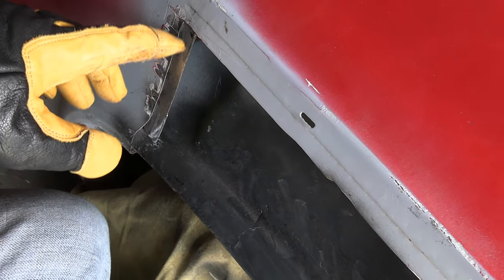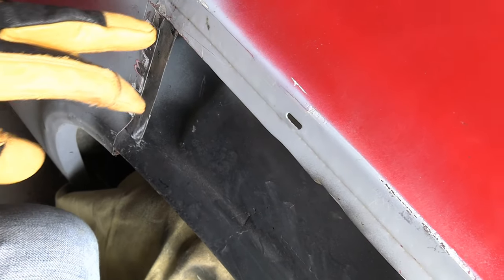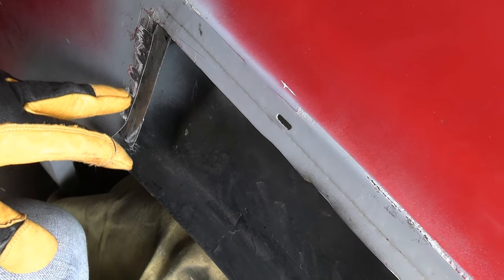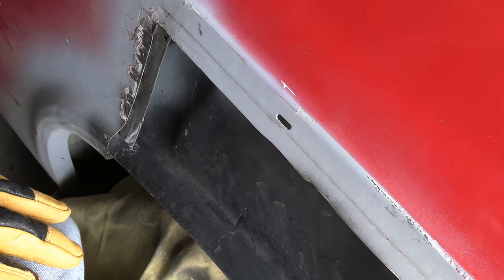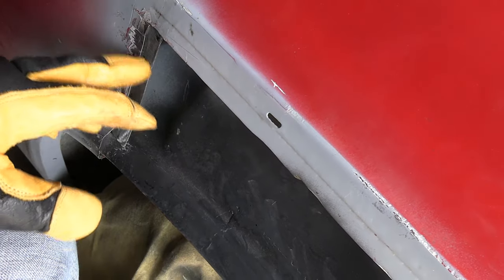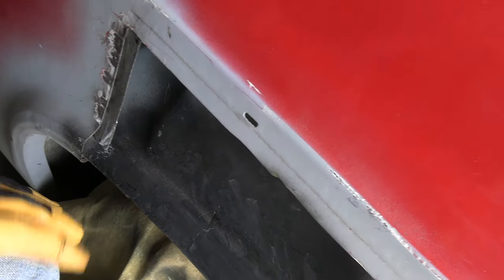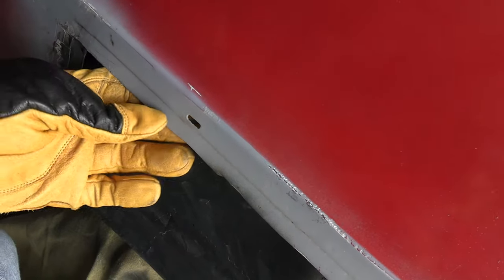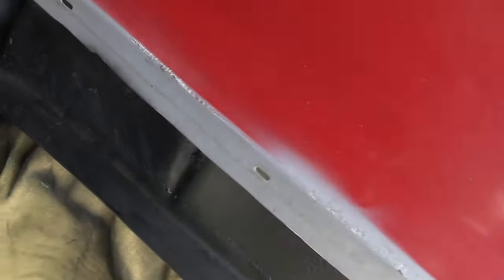The guys that had cut this out — I didn't get their quarter panels, I had to order new ones. This cut goes off into left field, so when I buck this up for a butt joint it gives me about a quarter inch gap, which is pretty gnarly. So I just put this backing plate on here with a couple of plug welds so I don't burn through. I'll probably flange the other side, then cut my rear quarter panel to fit right up in this flange and stitch weld it.